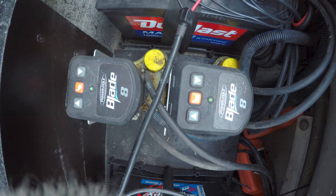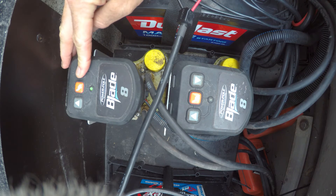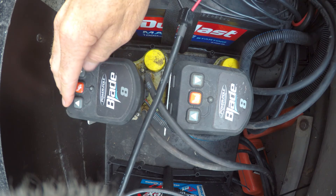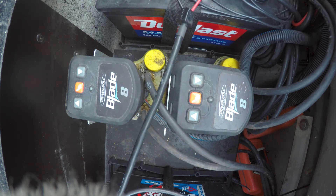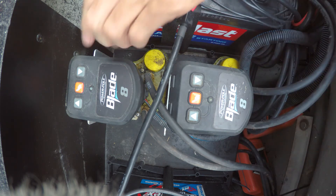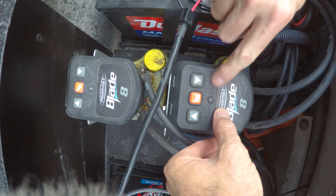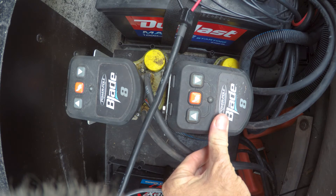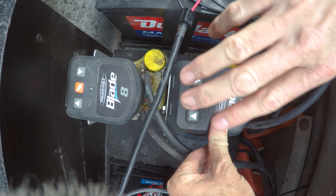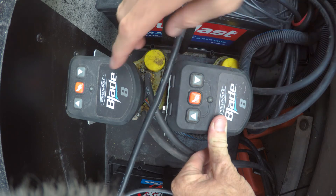Turn the power back on. That's the one — it works. Boom, this one doesn't work, this one's bad. Let's look at the signals and count them. About one second each — they're flashing the same. It really ought to have a different code, maybe a red flash or a one-two-three pause to tell you something's wrong, but there's nothing. It just flashes straight up one per second, same as the good motherboard.